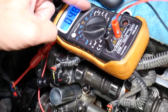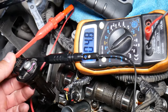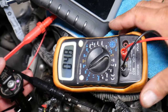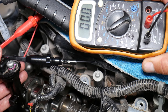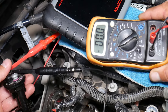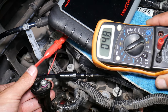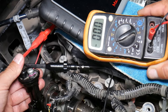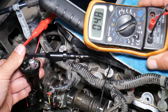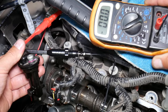We found the problem — I actually had the hold value button pressed, it wasn't the wires. The wires are good; everything's communicating at five volts — 4.8, close enough. Now testing the right sensor: zero, five, zero, five. If you hold the probe near the magnet it can change from zero to five when you pull out. It's important that when you touch it the value changes, and when you remove it, it goes back — and that shows it's a good sensor as well.